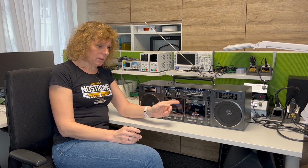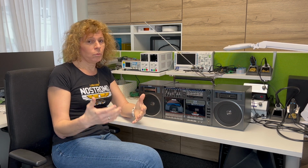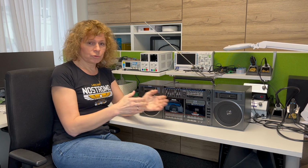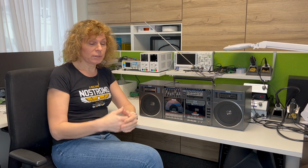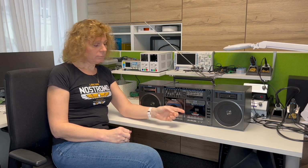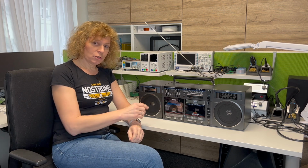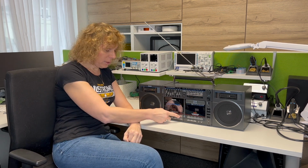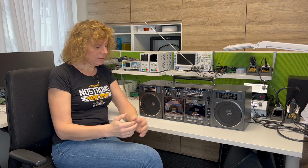And if a gear breaks and the tape mechanism is not able to execute its home position, the microcontroller controlling the tape mechanism will hang. It's just waiting for a signal which will never come. In this case, you cannot open the tape mechanism lid anymore. And you cannot use the CD player either, because the play, pause, and stop keys of the CD player are controlled by the tape microcontroller, which then hangs.